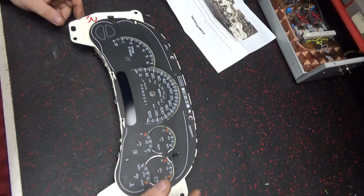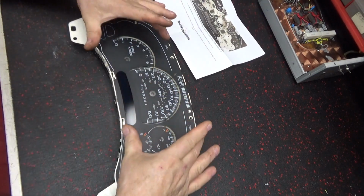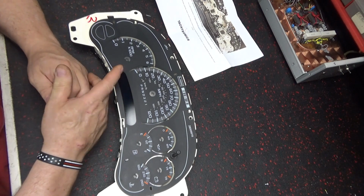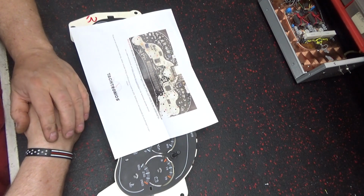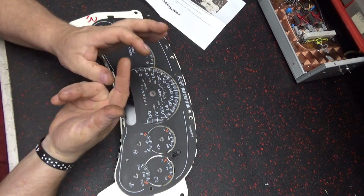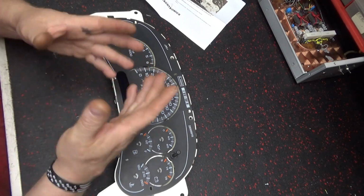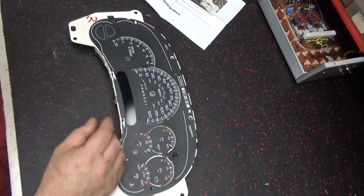I might change this one day if I can afford it. They was wanting to do a whole cluster, and they got some badass chrome bezels that fit around it and some different things for this, but this here cost me $35 for these LEDs. That seems kind of high. I think I could have went in there and put LED strips, like 2 or 3 lights at a time. Or I could have took LEDs and put a little bulb on it and put them in there. But then again, the way these are made in that block form, if you put a regular LED in there, it only shoots the signal forward. It don't spread it around. The way these are made in that block, they not only hit the top, they hit all 4 sides plus top. That's my understanding of that.